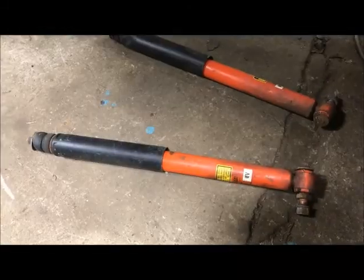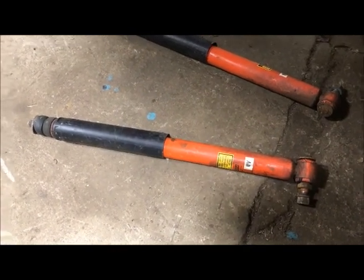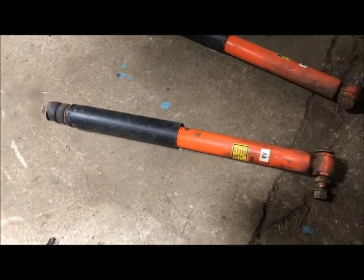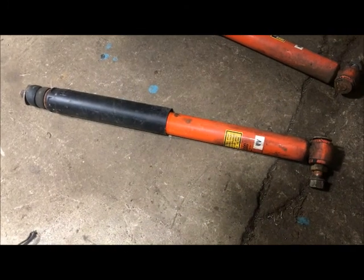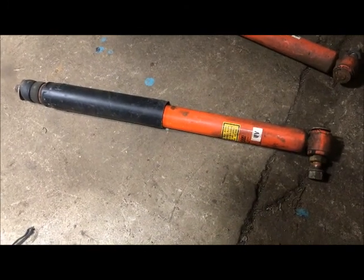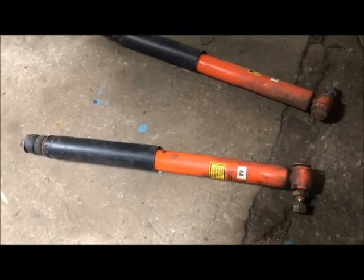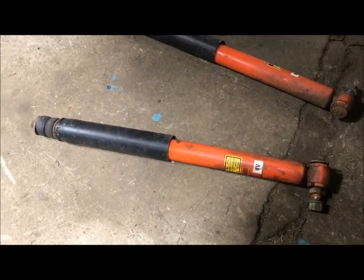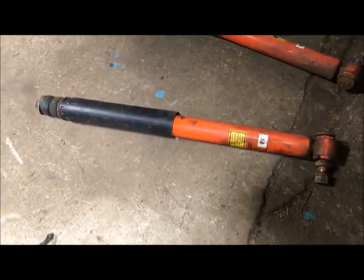All right, so, well, first thing, other than my axle being 2.5 inches lower than ride height, the other measurements as far as shocks are wrong, because I'm measuring off the center of the axle, and that's not where you put your shock mount. So forget that. I'm not good at making videos. I'm used to just doing this work and just banging it out. So anyway, this is how it'll get done.